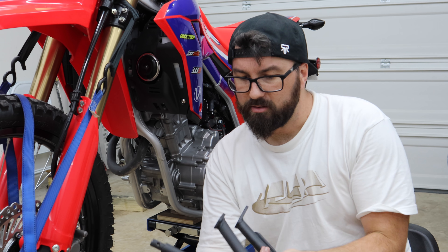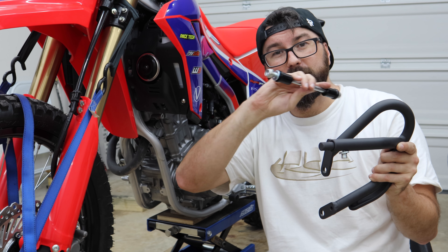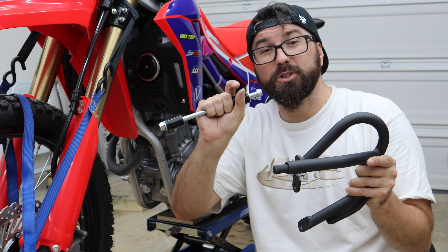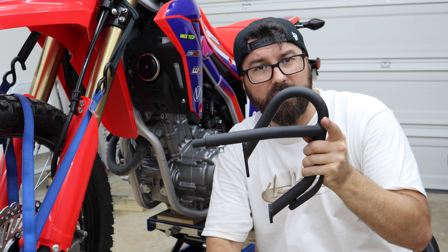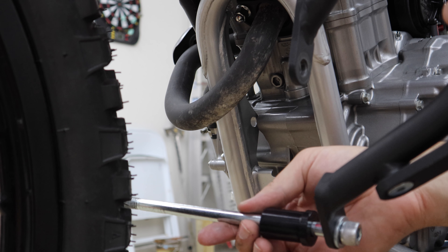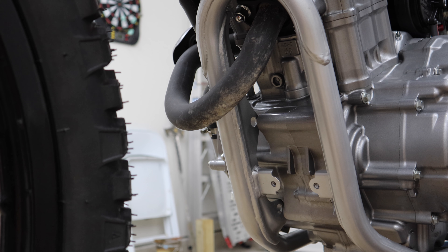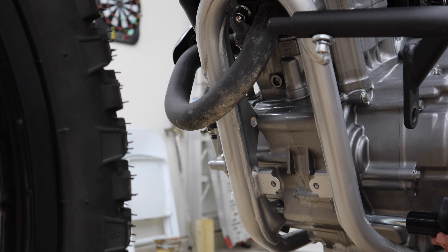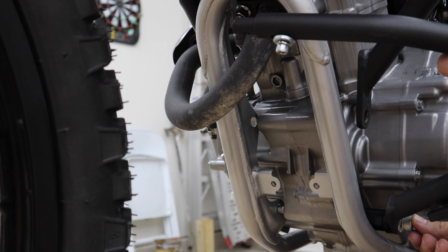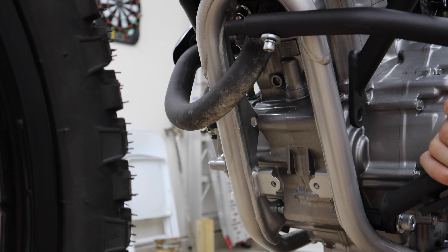I'm going to start with the piece that goes on the left side. It's got its own giant bolts that go through there and replace those big motor mount bolts, but we do have to use those little aluminum spacers — we need to sneak those back in there. Start with this one, everything in loose, then slip the other side in. You've got the longer bolt on the bottom, then a washer, spacer, and the bolt. Got the other one sitting up here without letting it slide around and scratch up all this pretty new paint.